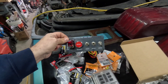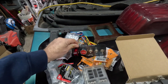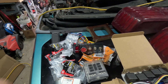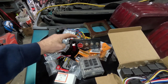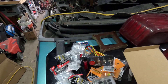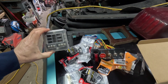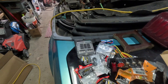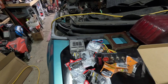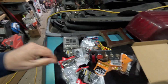I also picked up this switch panel here. I wanted to be able to isolate the ignition and the fuel pump, and then have one master switch where I can just shut everything down when I want to. We got a marine fuse panel, so I'm going to do this all independent, but then at the same time it's going to be wired to the key — bypass that and go right from the battery to the fuse panel to the switches.